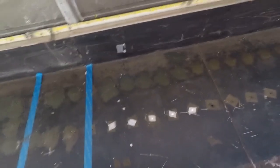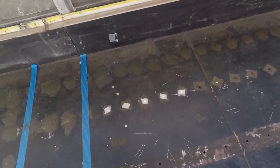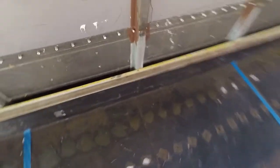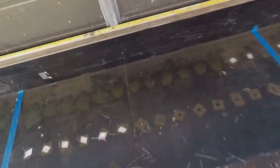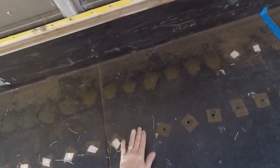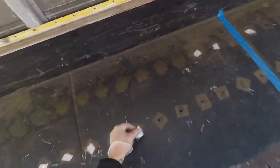It's important to cover these holes to prevent moisture coming in from the bottom. This is kind of the base of the build — you can't go and fix this when you've built everything on top later on. That's why I'm doing Bondo glass: it's a permanent fix instead of just tape, which could over time get moisture from underneath, slowly peel, and let water in.